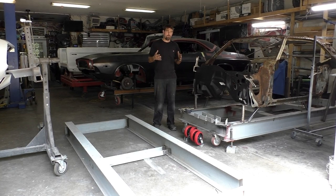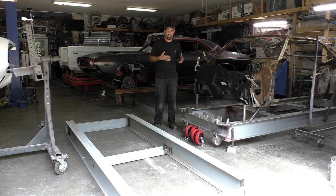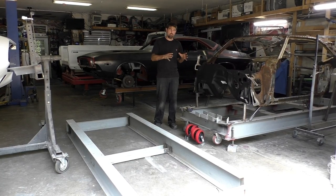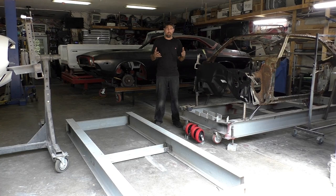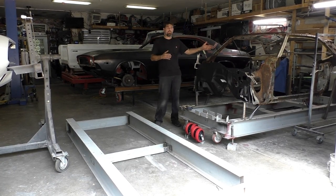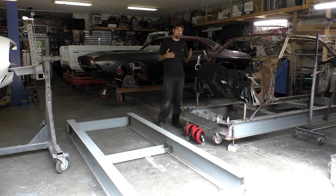If you're doing small chassis repairs, you're installing subframe connectors, or you're cutting small patches where you're not taking the structural integrity of the car and throwing it out the window, you could get away by loading the suspension on a level ground and doing your work there. But when you get to the level that you start really stripping these cars like this Firebird, a frame jig really is a must.